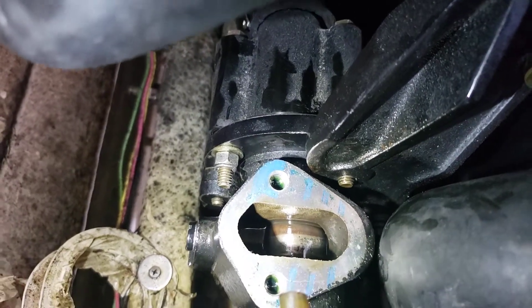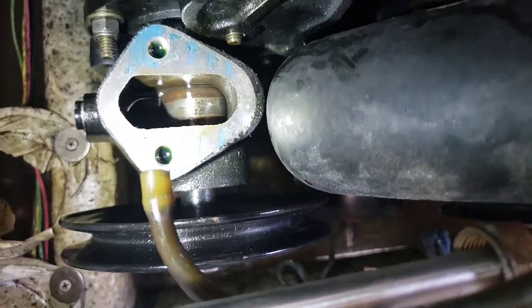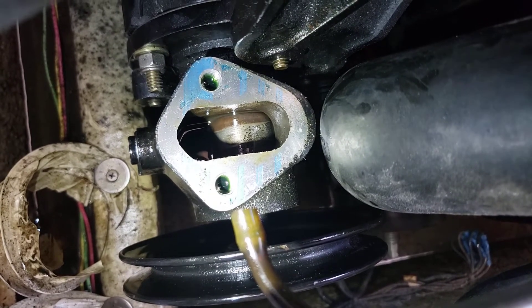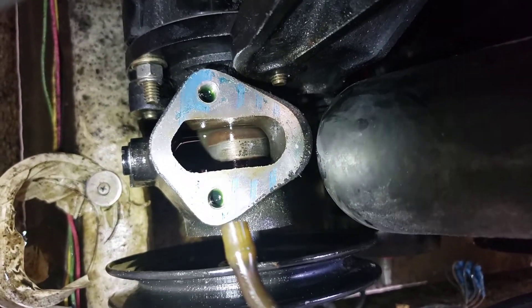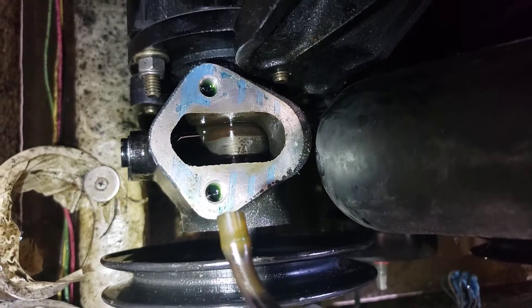Most people are familiar with this, but what some may not know is that inside, when you pull that fuel pump off, there's oil and a little eccentric — like a cam lobe — that actuates the fuel pump up and down. This customer was complaining of a fuel delivery problem and was considering going to an electric fuel pump, having done some research, which helped us with diagnostics.